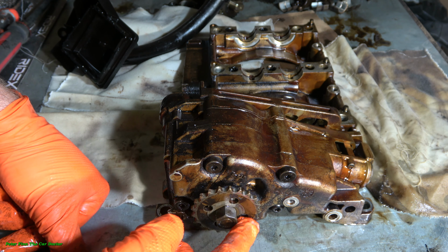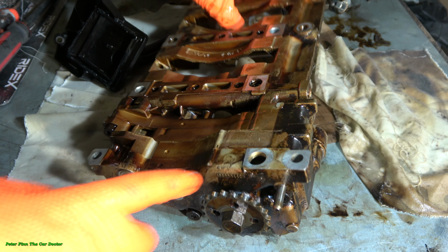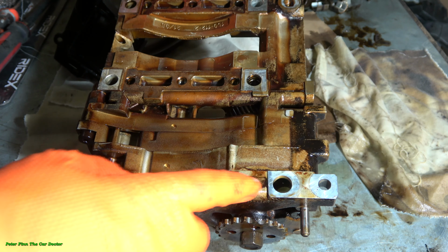This is really a shaft where the chain goes to this timing chain area. This speed is the same as the timing chain or timing belt, and when this rotates in that way, oil goes inside in this inside place, and then after that oil goes through that hole to inside the car engine or truck or SUV engine, and there is high pressure in here.